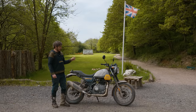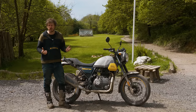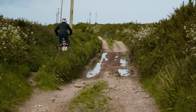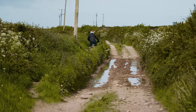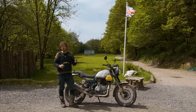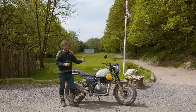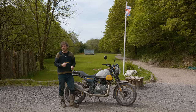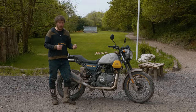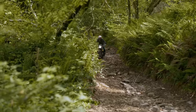They've removed the option to turn the ABS off on the rear wheel, which you could do on the Himalayan. I don't think that's particularly a huge issue — unless you're riding really aggressively, if ABS keeps cutting in you're probably riding beyond the bike's ability. The sad thing with the Euro 5 Himalayan and Scram is that when you remove the ABS fuse — which you used to be able to on the Euro 4 — now there's a wheel speed sensor in the rear wheel, so it cuts out your miles-per-hour indicator. So leave the fuse in and just ride it as intended.